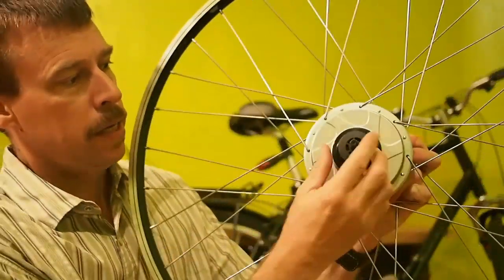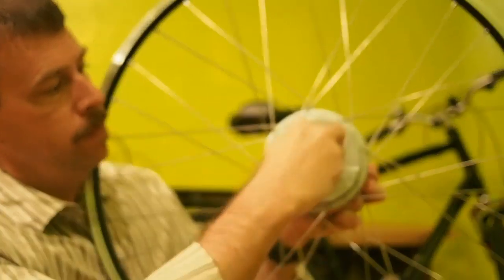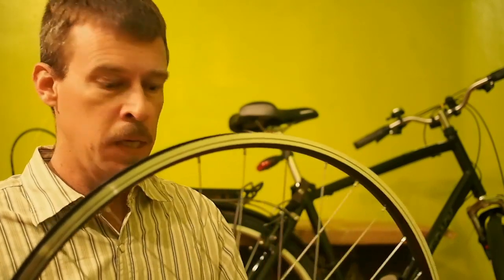If you don't lace wheels, you can ignore that and just take the NuVinci to your local bike shop and have them put a rim and spokes on it. Now, the NuVinci has an analog shifting mechanism — it's never out of gear. All it does is change the ratio without gears, really. It's got little balls and spindles that tilt, changing angles. Because of that, there's never any clunking. You change the ratio by twisting the shifter — at a stop or moving — and it's instantaneous. This is a very good fit for an electric bicycle.